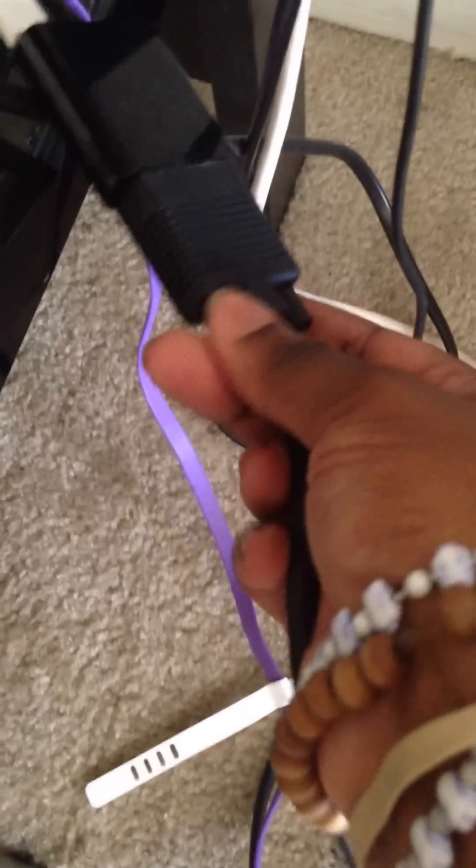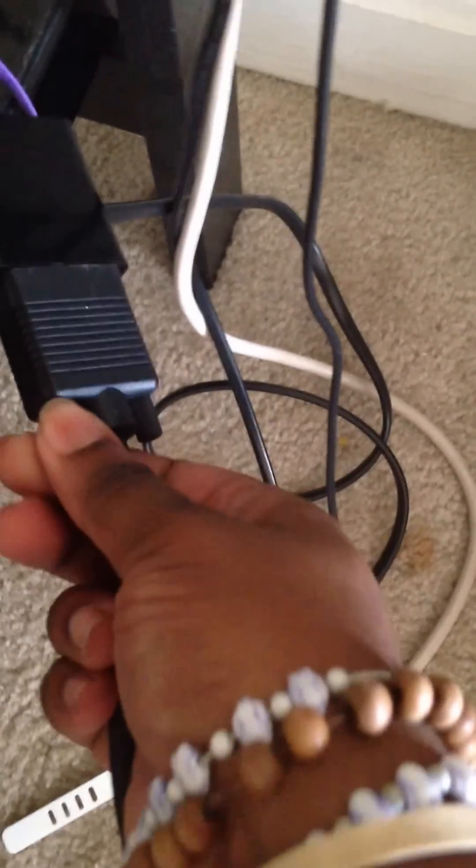Also make sure the adapter has an audio port. If not, you can use your PS4 controller headphone jack for audio. My speakers do have one — they're relatively cheap, about $8. Make sure it has a 3.5mm audio jack. You can even use Bluetooth speakers for this. My adapter has an audio port, so I'll go ahead and plug that in — now I can get audio out of my speakers.